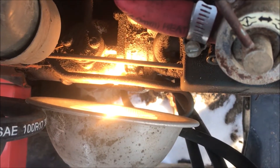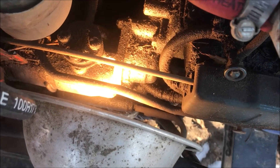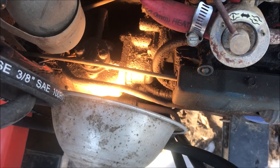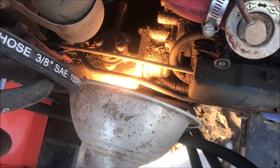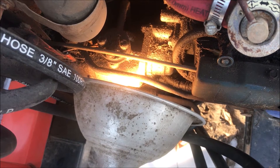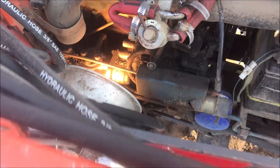I took this heat lamp — right now I have a 90 watt incandescent bulb in there shining on this side of the engine. I'm about to throw a tarp over the top to make a kind of tent, then I'll make a run to town to get an actual heat lamp bulb. I'm going to let this thing sit for a few hours. They're forecasting 35 degrees later today, and I'm hoping the direct heat plus the warmer temperature will allow me to get this started before the storm rolls in.